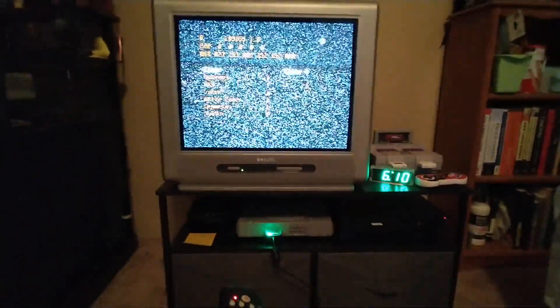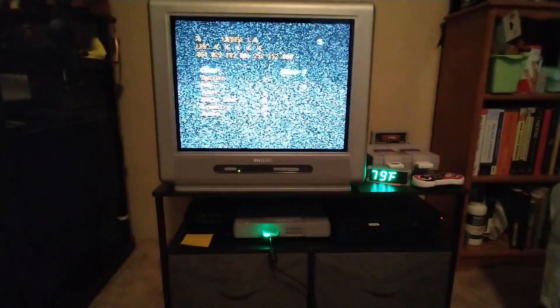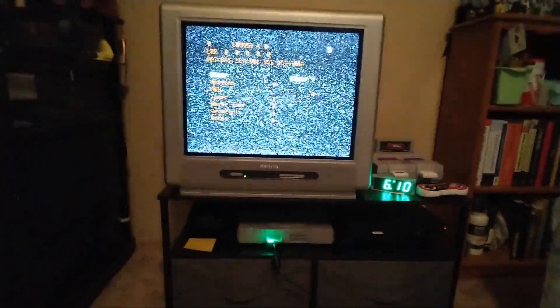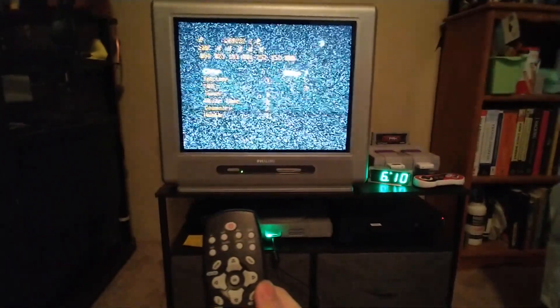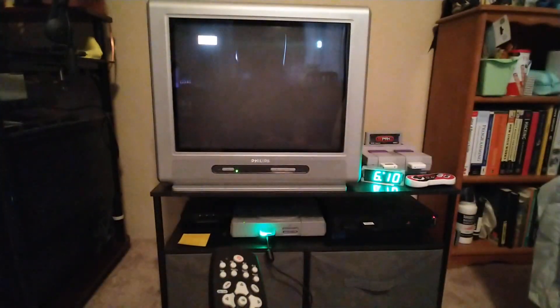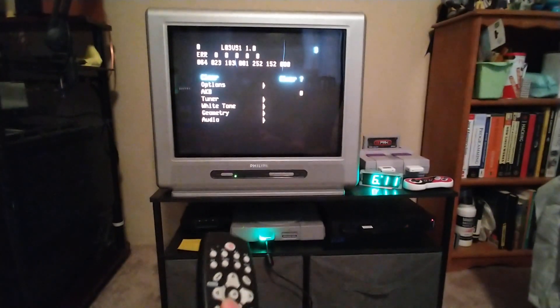We're on the tuner right now because the TV interprets the first few numeric key presses as us trying to change the channel. We want to try an input we actually care about. The way I do that with my universal remote is I switch modes — there's a red light blinking. I switch to the mode where the red light is not blinking, then the menu key changes into the I key. I press the I key to make the service menu go away, go to an input I care about like component, then press the I key again to bring the service menu back.